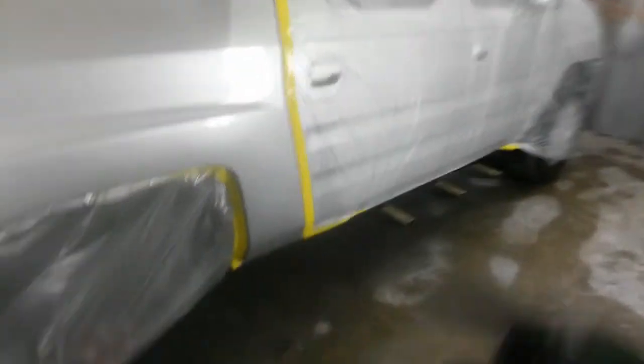Here's another example of poor work - part up here is exposed with body filler right there, and bare metal has been rusting. You can see from inside the bed that it's exposed. I'm going to have to sand through that and make sure I cover it this time so it doesn't look like I did it. That rail cap only goes to right here, so I want to make sure I get behind this edge. There's body filler still in there that didn't even get primed.